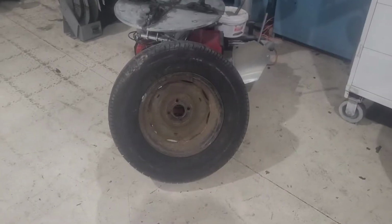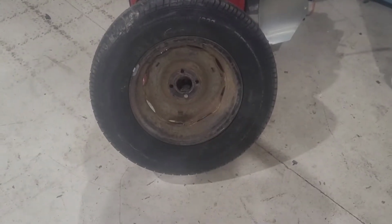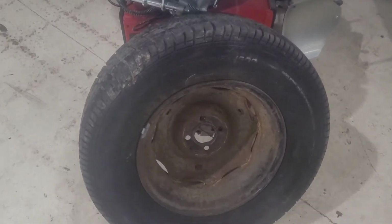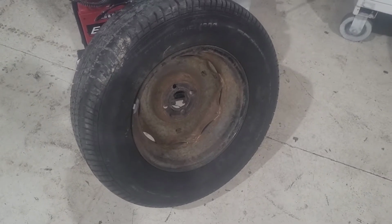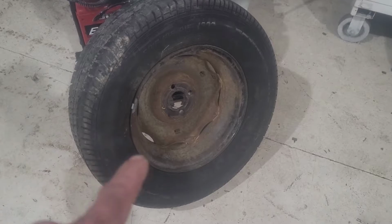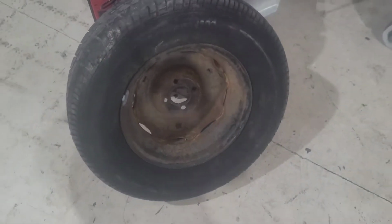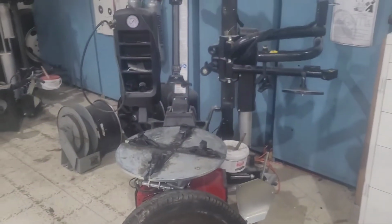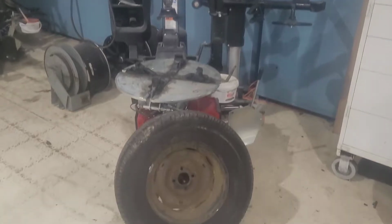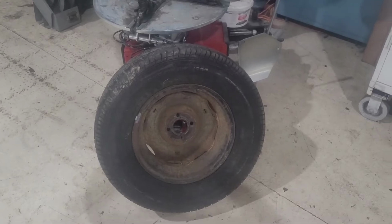Follow me along. What I've got here is a 15-inch wheel from a 1950 Studebaker. 4-lug, good rubber, but it slowly leaks air over a week or so. My father and I put it in a tub and found out that the rivets that hold the center, you can see them right there, really slowly leak. Only 1 or 2 of them do. So since I have the tire machines in work, I'm going to break the tire down, pull it off, and go on the inside and weld those rivets to the hoop.